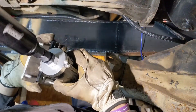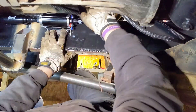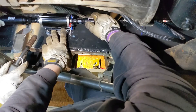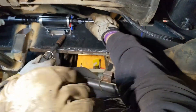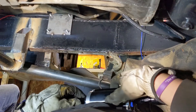We've got a sweet little plate made that the fuel pump mounts to. We'll weld it up in here, get it up nice and high and away from the driveshaft — there should be enough room back there. It looks good up here too. Let's tack it in. That's going to hold. Look at that — that looks sweet.